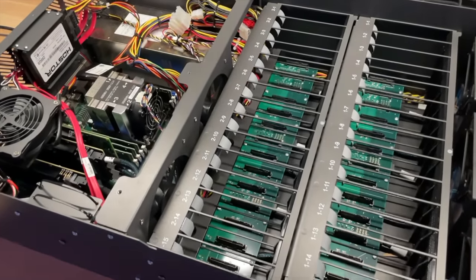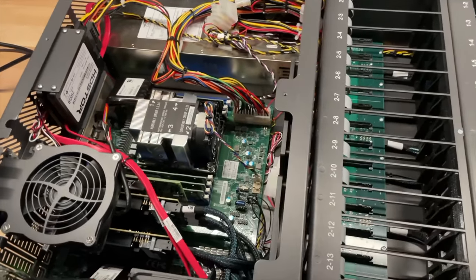My 45-drive server is built with a lot of redundancy, and one feature is that it mirrors the SSDs of the boot drive. It comes with two identical 500GB drives that are mirrored — they act as a single drive so that if either one fails, the system continues as normal. You get a notice in the console or an email, you replace the bad drive, and it copies the data from the good drive back to the new drive. Some NAS machines also use mirrored SSDs for the write cache, giving a big speed boost and helping avoid the write hole, where data is lost before making it all the way to the hard drives.